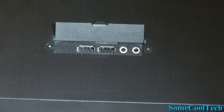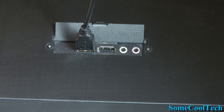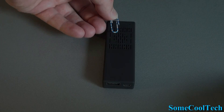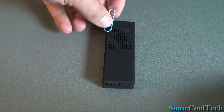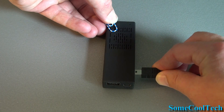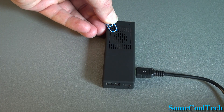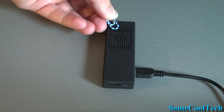Be sure your USB cable is connected directly to your PC and not through any hub or other USB devices. Now we're ready to enter flash mode to install the USB drivers. Hold the button down with the paper clip, and while you continue to hold it down, insert the USB cable into the OTG port. Wait about three seconds after you connect the power cable and you should hear a ding — then you can release the button.